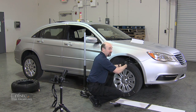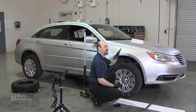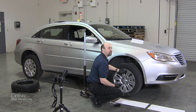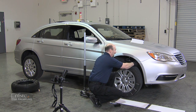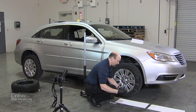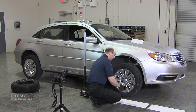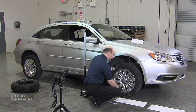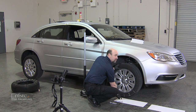Number one is going to come to the top as I'm inking over here, and I'm going to be taking the ink off onto the glove. So what I would like to do is rotate it by grabbing the wheel or the wheel cover. I'll ink the entire tire until I get it all the way back to the number one position, and then rotate that down so that when I drop the tire down, this first tire wear indicator is going to land on here.